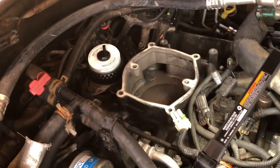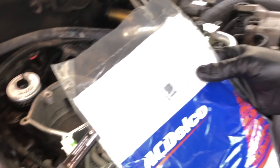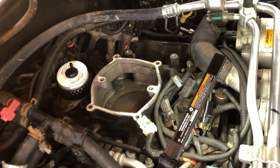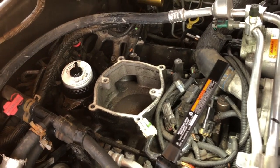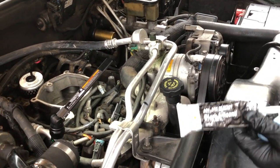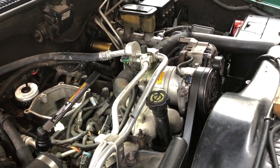We've had the intake protected while working. The white gasket here is reusable — if you've changed it recently you don't have to do it again. In my case it's never been changed, so I'm replacing it with GM part number 10137537, which has the same number whether you get it from GM or AC Delco. The crossover sleeve end also needs to be sealed, so we're going to clean up the old sealant from inside the sleeve and on this end, then use black silicone RTV sealant.